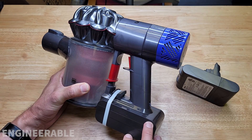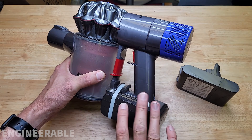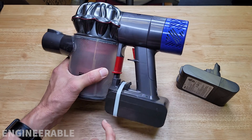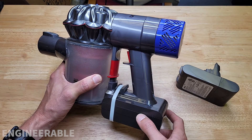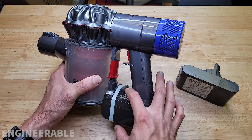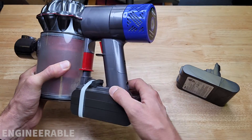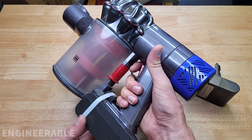With that in mind, I've used this battery for over a year now. This issue didn't happen after every single recharge — it would only happen every once in a while. So I couldn't keep removing the screws and removing the battery every time it happened; that got annoying. First, I tried putting a velcro strap around it, but the velcro strap was too loose and the battery would disconnect while using it, causing the vacuum to turn on and off all the time.